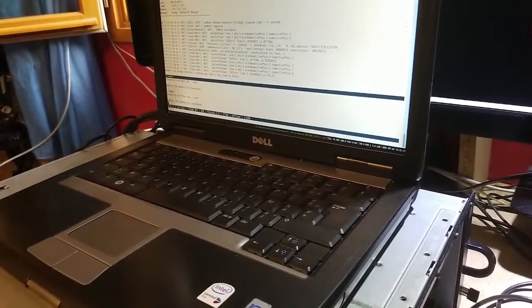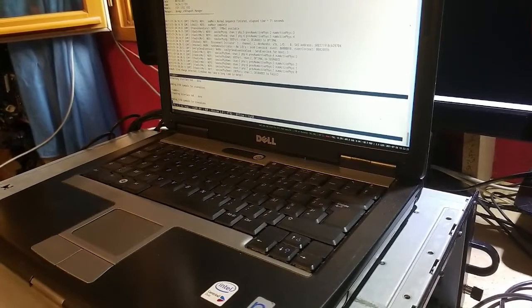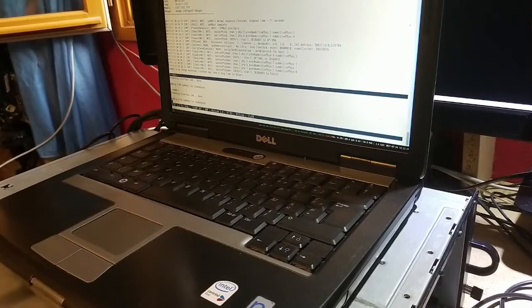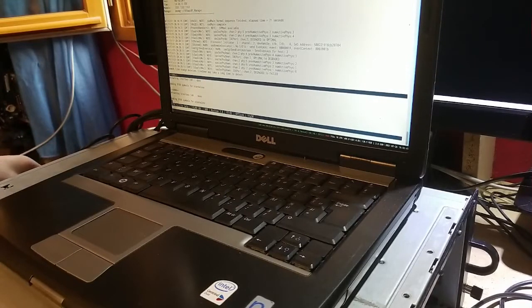The thing is that I already fixed the SAS controllers, and both of the SAS controllers had firmware corruption. So I'm pretty sure these controllers, which are iSCSI controllers, also have firmware corruption. To fix the situation, you have to get into the firmware recovery mode. Unfortunately, since the firmware is present and is trying to boot, we can't get into the firmware recovery mode.